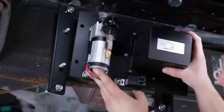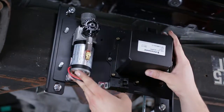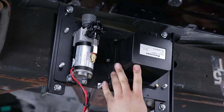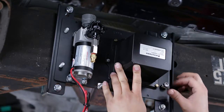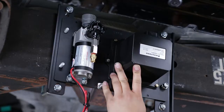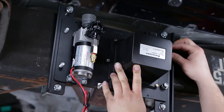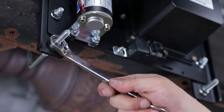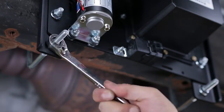Mount the pre-assembly to the frame brackets using the nuts provided. Adjust the frame brackets as needed to align the holes in the no-drill mounting plate. Place the pre-assembled no-drill plate so that the compressor head is above the airline to prevent any water trapped in the airlines from running back into the compressor head. Securely tighten the nuts on the frame brackets.